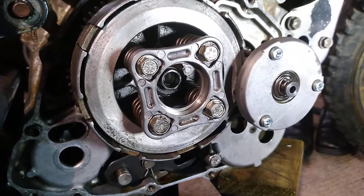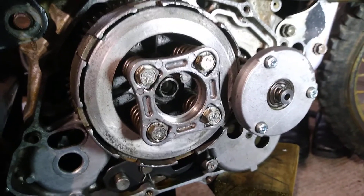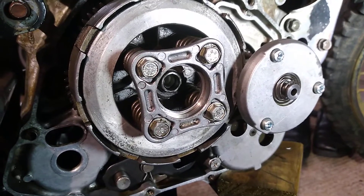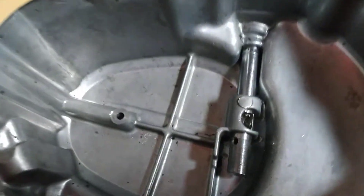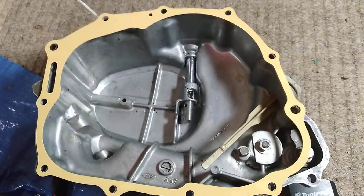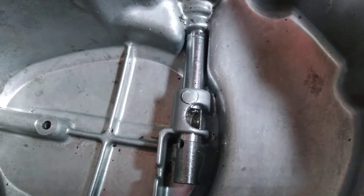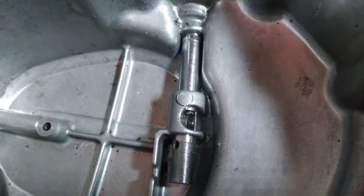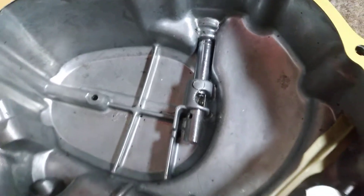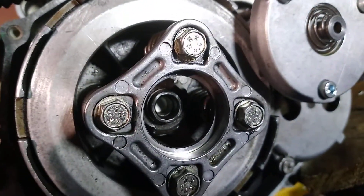The next problem is the push rod. The push rod for the CRF230, which I actually ended up buying from Japan, doesn't have an extended shaft — it just has the little round surface which goes against the release bearing, and then a little peg that goes down into the actuator, which is part of the clutch housing. But this clutch housing isn't for the CRF230 — I believe this is an XR230 clutch housing. Down in here it's actually a hole that the peg of the push rod goes into, to stop it falling out. This one is meant to have the extended peg that goes deeper through the bearing and down into the crankshaft.